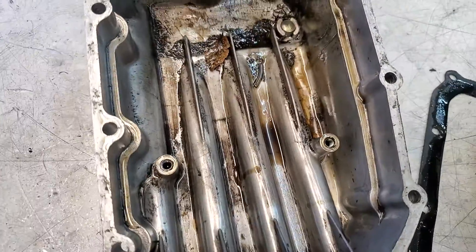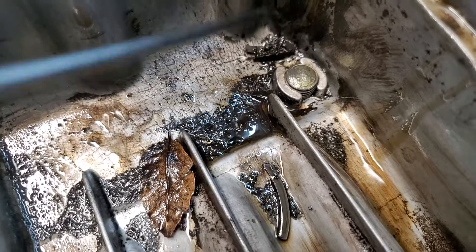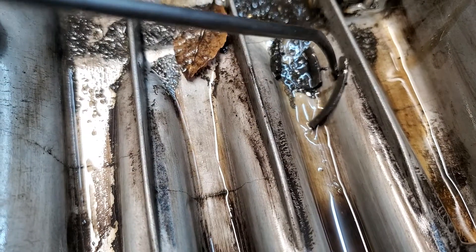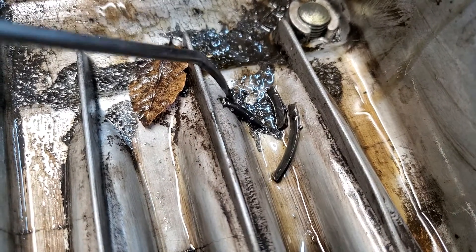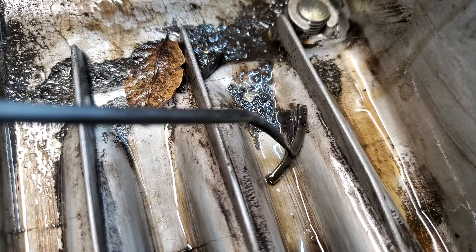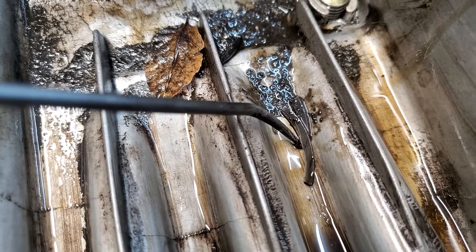The major concern is this big piece of metal and the remaining bits of it. If this is a piston ring — and I really don't think it is — it's so hard to tell. There also appears to be something organic in there. If it is a piston ring, there's just no way, because if it was, your bike wouldn't be running right now. It would sound like you were running the bike down the street with castanets. There's just no way.